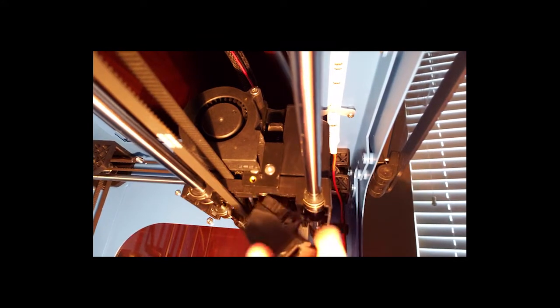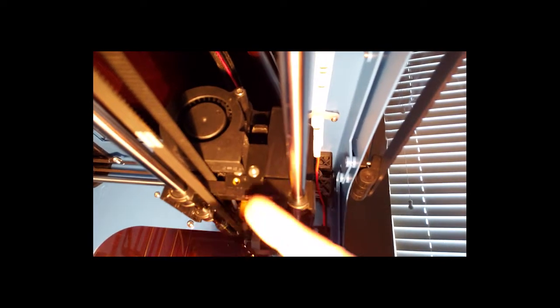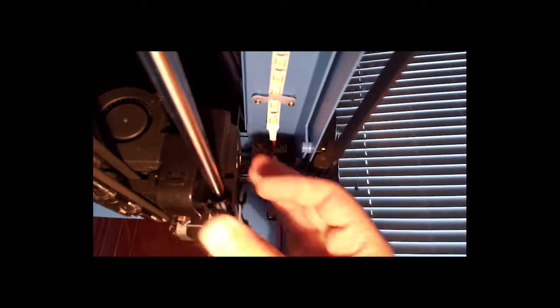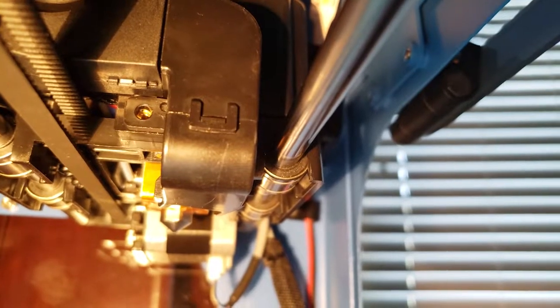And you'll notice on the air vent there's two little holes. One of them is for the screw and the other is for a little tab that's sticking out right next to where the screw is going to be. You want that tab to go into the little hole when you snap it in place. So it's going to go in, and you almost have to pry it into place. There it goes. Okay, I think I got it. It's close. So when you get it in place, the little tab will go into that little hole there. Now we can put the screw in.